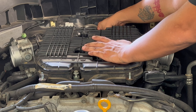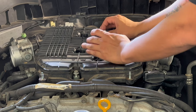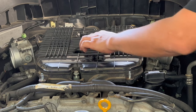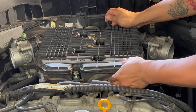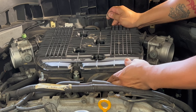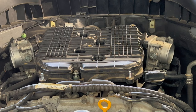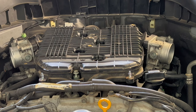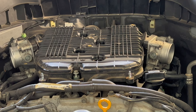We took out this screw in the back and the other one, so we have two of these and then the one, two, three, four, five, six long bolts — probably like four-inch bolts down. So you can see it's moving. As you do that you can see which lines will snag and hold your intake manifold down. Some hoses are coolant hoses, so when you take them out they might leak some coolant — just try your best not to get it all over the workplace.